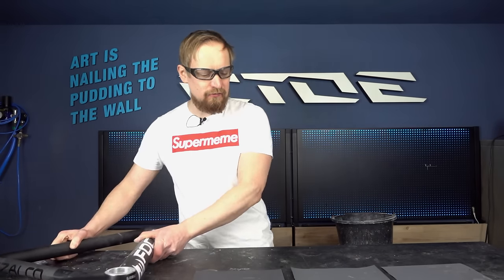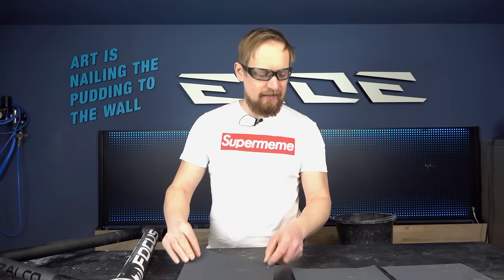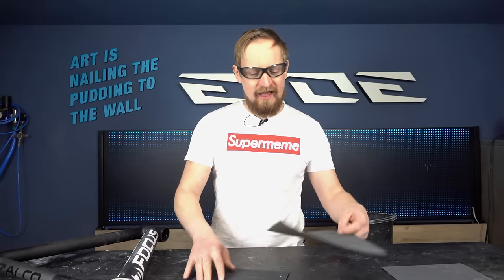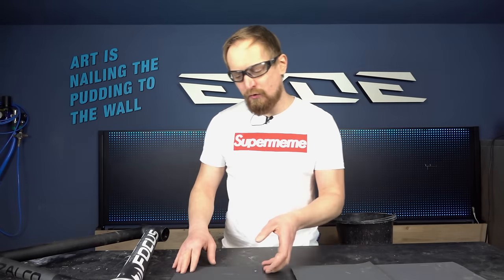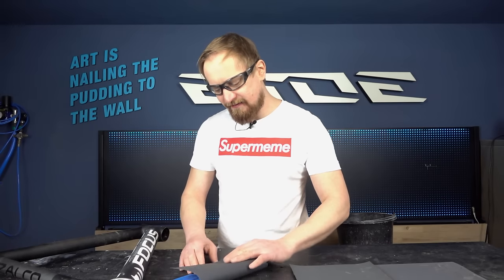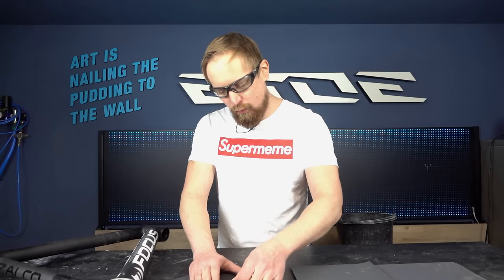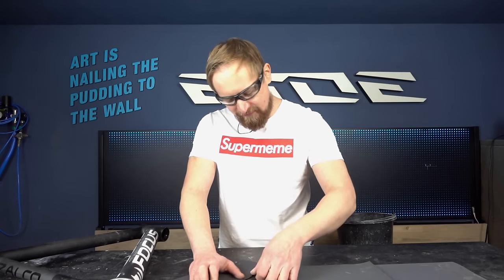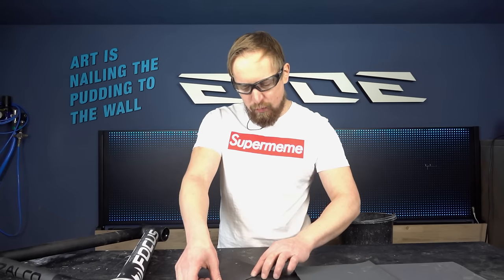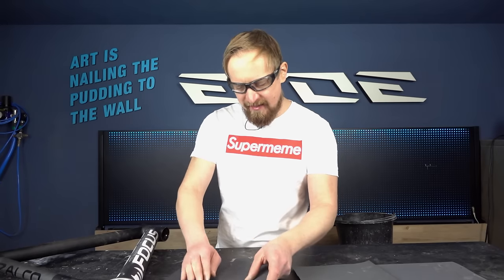And to do so, we will use different grits of wet sanding paper. We will start with 400 grit, next is 600 grit, and the finest is 800 grit. And this step also divides the toys from the pros and decides if somebody is laughing at your cringy paint job or somebody gets wet eyes when staring at the high quality paint job you did on your frame yourself. So decide what you want. I recommend to remove the complete color. And it's simple as hell.